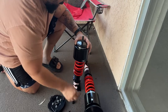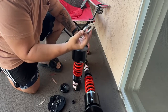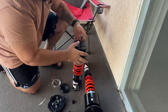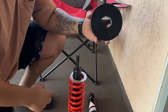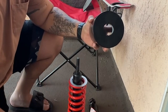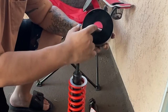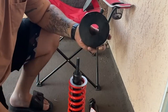There's a spacer and a spring retainer. There's a little washer they provide with the set, and down here they tell you to take different measurements of your stuff, because the O-rings that lift it up and down seal against different parts depending on your shock. The rears are different — I'd show you but I don't feel like taking them apart again. So you have to measure the thread thickness and the hole size, and then they'll send you washers and all that.